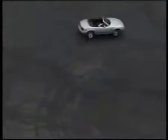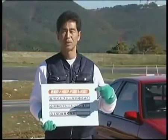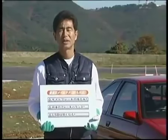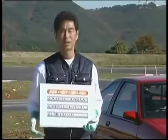The car won't exit properly, and sometimes kills the drifting. You only end up with worn-out rear tires because the inner wheels keep spinning. It just ruins the fun of drifting. So make sure to overhaul your LSD and maintain your drift machine in healthy condition. You will have more fun on a well-maintained drift machine.